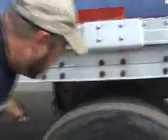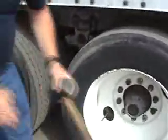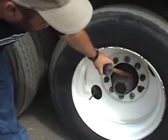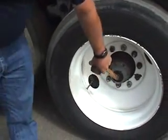We want to strike these tires, make sure that they're full of air. We want to make note that there is an oil hub on the rear. We want to make sure it's not dented, cracked, or broken. No missing nuts or bolts. It is not leaking around the bolts of the seal. And we can pop this rubber grommet out to check level.